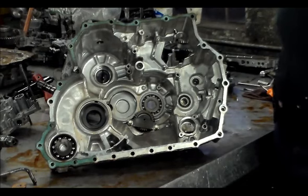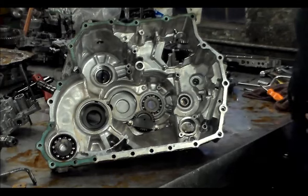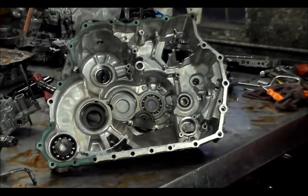At this point it was winter out. So I wrapped the valve body in a bag and buried it in a snowbank for 3-4 hours. I didn't have any issue, no stuck valves at all. So I knew at that point I had a solenoid problem. I changed the solenoids and that fixed it. So just a little trick there if you have an issue cold and not hot.